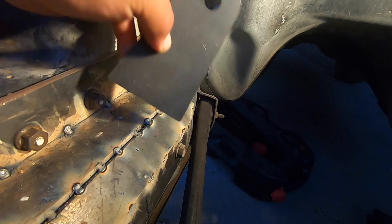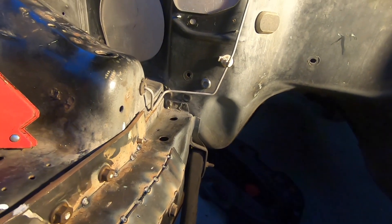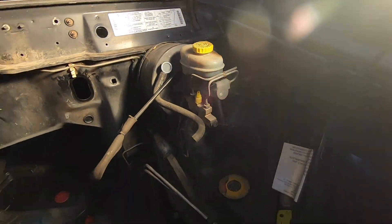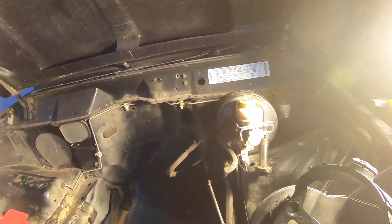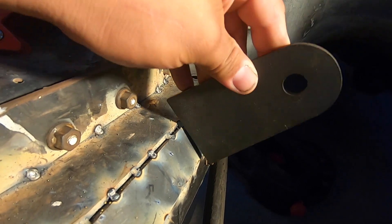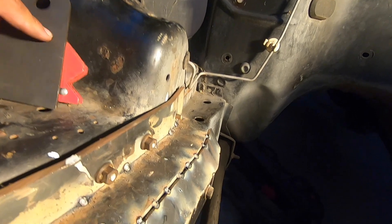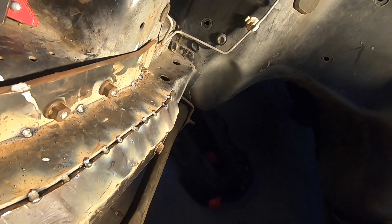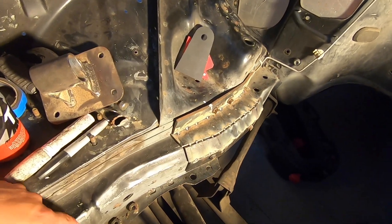The plan is to cut the lifting brackets to whatever angle they need, cut them out of cardboard first, bolt them on the engine, then trace the shape onto the actual metal — that should show exactly where they're gonna sit. The design might go like this, like this, or like that. Once that's done I'm gonna weld them onto the mounts, and I'm also gonna box them in just to add a little extra strength — since we are gonna beat the hell out of this Jeep, might as well do it. That's it for this video, thank you guys for watching, like, comment, subscribe, and we'll catch you in the next one.